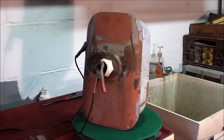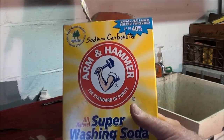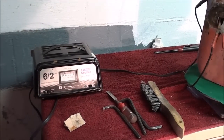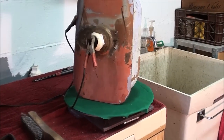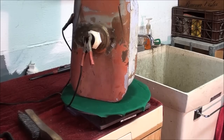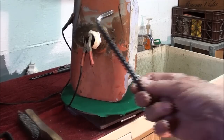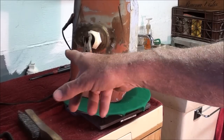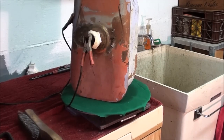Real briefly, if you haven't seen the other videos: electrolysis is the process of using washing soda — which is sodium carbonate — with water, along with a battery charger or power source, and an anode which is stuck in the neck here. What is different about this video than the other ones is that I used an open tank and was de-rusting parts you could see being done. In this case, the gas tank is the vessel for the electrolyte, and the anode is stuck into the hole — so it's an internal type of electrolysis rather than external. That's what's different, and that's why I'm bothering to show this.